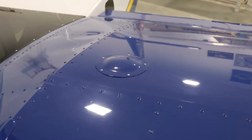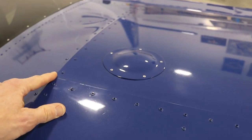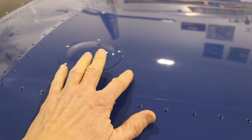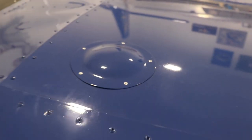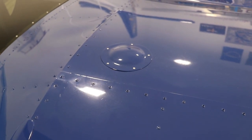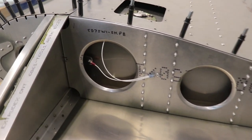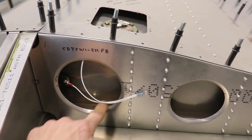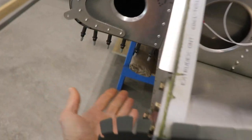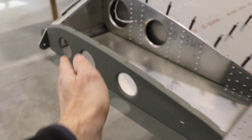If you've been following my channel, you'll know that on my cruiser I mounted my fuel senders on the top of the tank instead of the side, which is where Zenith mounts them. On the cruiser they stick out past the skin a little bit, so I made fiberglass domed coverings riveted in place. I'm doing the same on my Super Duty. The location Zenith mounts the senders is on the side of the tank, but let's pretend the wing is finished and installed, with skin riveted all the way back and the fuselage right there.